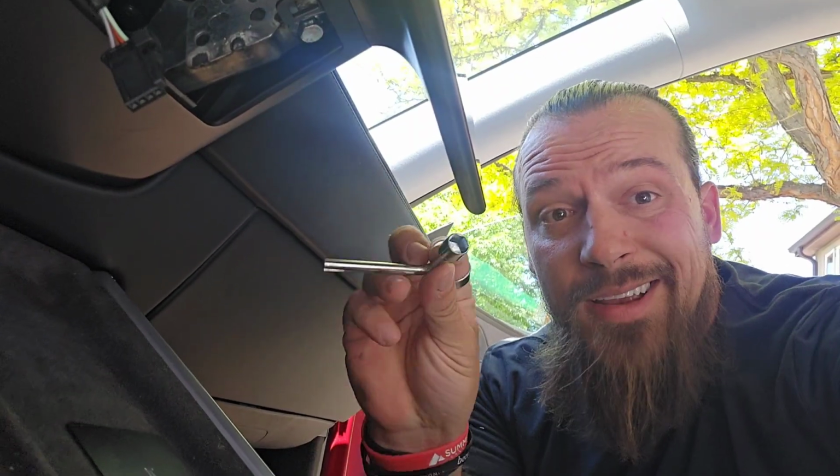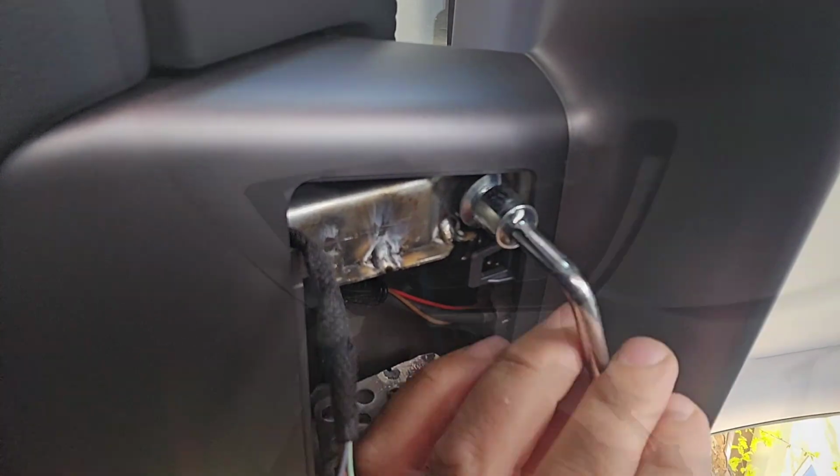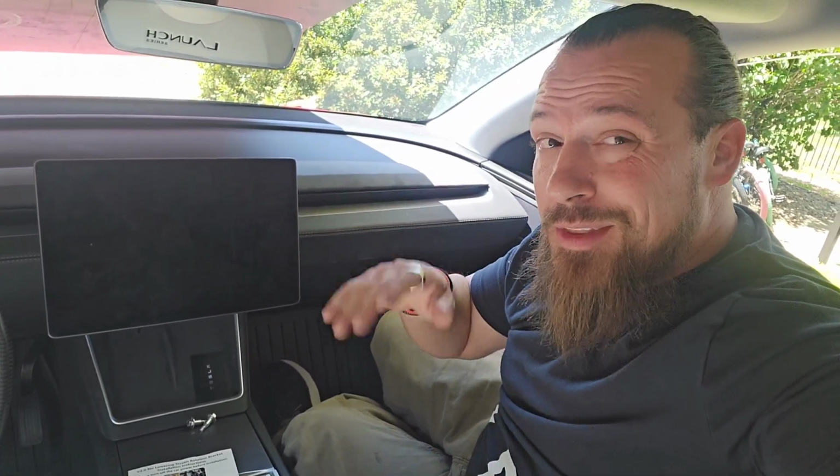And in this particular kit, it includes the wrench you need to do it. So using this provided wrench, I just backed out each of these screws one by one. They were pretty tight initially, but once you got the initial break plus maybe a turn or 2, then you could get them out by hand. So now the next step is to actually pull the screen off. And those are the only 2 bolts holding it on. Now in my experience, it's a little tricky to get off. So you have to kind of shake it back and forth while you're actually pulling out, but that's all normal.